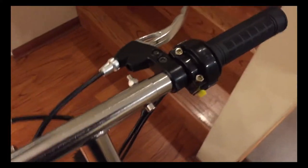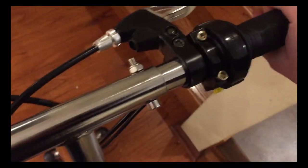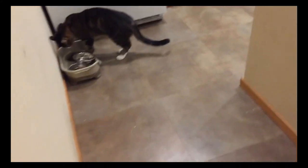Depending on how the magneto is set up, you might have to push or hold the kill switch. You've got a twist throttle — this does need to be adjusted. You can adjust it by going here and screwing around with these. This is your locking nut — it locks against this bigger nut, and you can make it tighter or looser. Also on the carburetor there's the same thing — a locking nut and a little nut that allows the cable to slide out. On this 2017 model you've got a start and run sticker rather than an on/off switch, plus an EPA certified sticker.